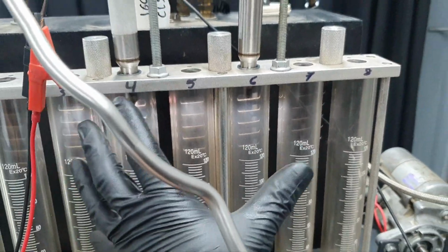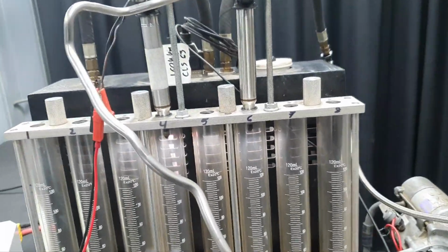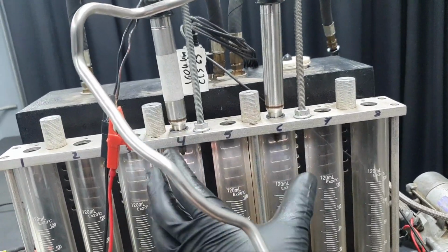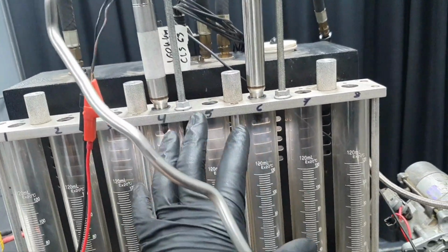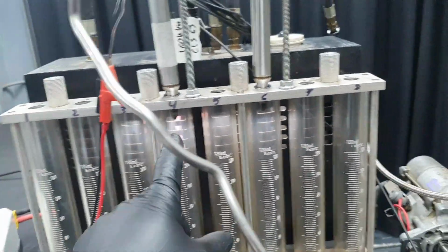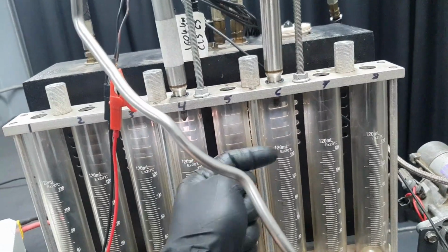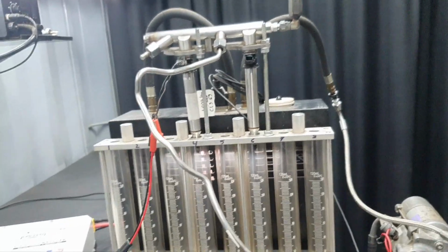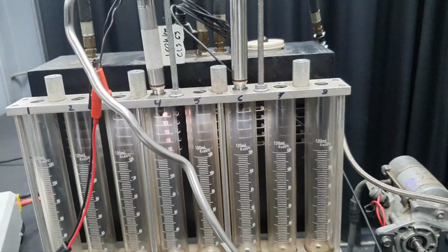Imagine that currently, like I said, it's very important. That's why I'm saying it again, it's the third time that I mention it. These are at 25 degrees. It doesn't have a hot cylinder head next to it. It's not at operation temperature, and it's important to be at operation temperature. Currently it's at 25 and you see how much it's leaking. If you watch the video of this injector, the stream of how it was leaking inside, you can see it was much faster. Within a minute it was losing 20 bar from the rail pressure when it was mounted on the car.